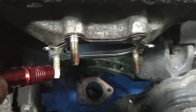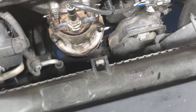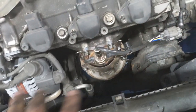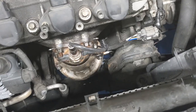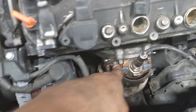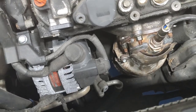I almost forgot to put the donut gasket in the J-pipe — do as I say, not as I do. I've also got the new gasket up here on the manifold. I've got some bad news though: I believe that oxygen sensor was supposed to be a downstream one, but they sent me an upstream. The connectors are completely different and the harness isn't long enough. So I'm going to have to put the brakes on this for now and see about returning that one. Torque spec on these bolts is 23 foot-pounds, tightened in a star pattern.